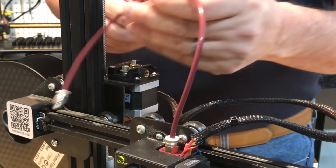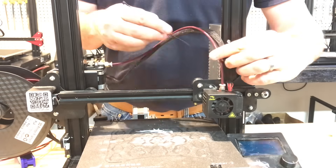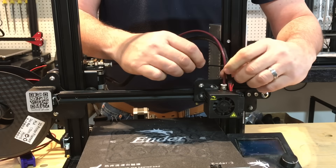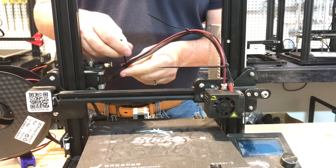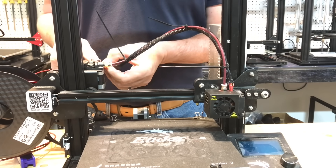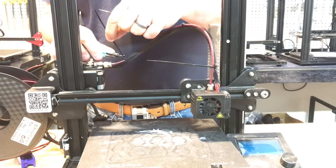The next step is to install the coupling into the extruder bracket — it should fit nicely. The threads feel really good, nice and smooth, and it goes right in. I just hand-tighten these; I don't use a wrench because I'm going to have to take it back off at some point. Now we need to put the tie straps back on. I push the hot end all the way to one side, line up the wires, and put one tie strap there — tight but not too tight, snug but still allowing the PTFE tube to slide a little. Then one in the middle, and one right down here just outside the coupling. Once they're in place I'll clip the wires onto the bracket on the extruder and then test it — go back and forth and make sure you're not feeling any binding or grabbing by that PTFE tubing. If it feels good, just clip the tie straps and you're done.